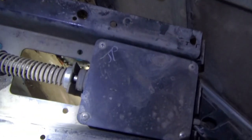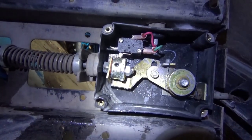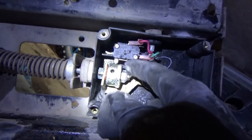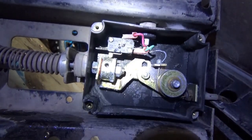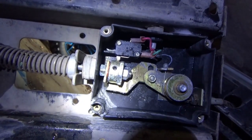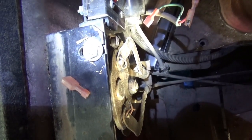Now we need to get under the cart and look at this foot switch to see if we can restore it — no parts required. I got the foot switch assembly off and there is water dripping out of this box. Let's see what's inside. Pretty simple setup — this little switch is toast. It's not like it wasn't giving us any power, but it wasn't passing enough current through. We can try to take it apart but it's not even spring-loaded — looks like it's all rusted up. So we're going to remove this switch and connect the red wire to the green.